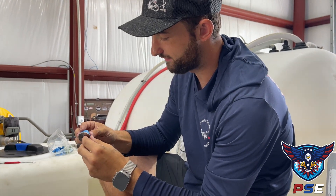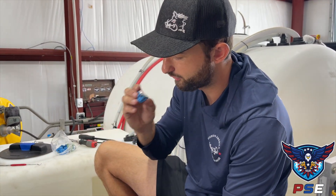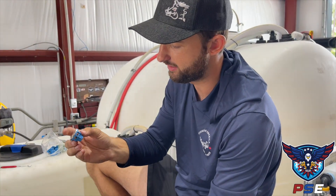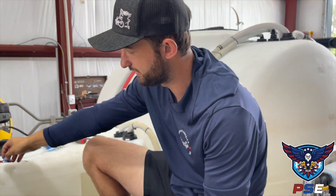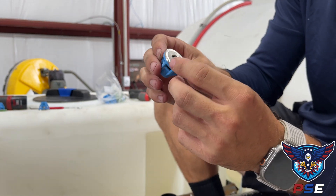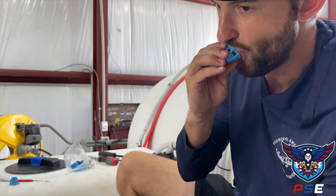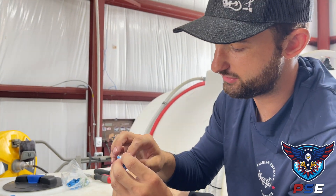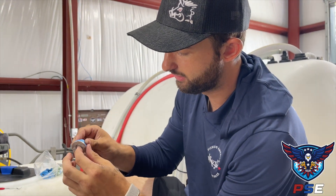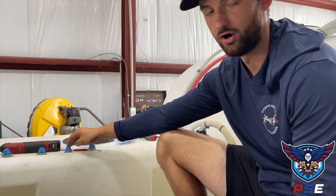Here's the difference between a good check valve and a bad one. This one we just pulled — if you blow through it it functions, you can hear it, but if you suck air back there's nothing, which means it's sealing properly. This other one pulled from another unit shows some buildup, and if you suck through it you can hear air coming through. That means either the seating is calcified and not getting a flush seal, or the spring has deteriorated. There are a lot of variables, but that's an easy way to tell if your check valves are good or not.